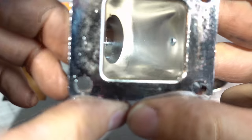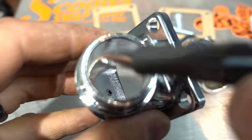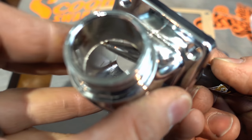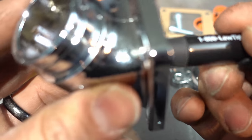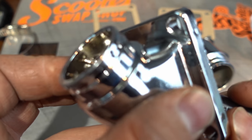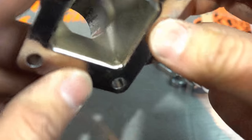The Honda Dio CT manifold — the plating is just as bad. See this area — that's just a big chunk in the plating. I'm literally just chipping it away with my pen. Everything's supposed to be smooth with your carburetor guys. You can spend all this money on your parts and then put something like this on — it's pretty bad. If you get this intake manifold, you really need to clean all this up. You can actually see a lot of this is already bubbling right now, and this has not even been used over time. All this stuff is going to chip off and get sucked into your motor.